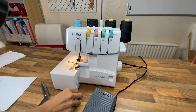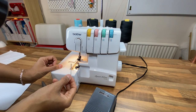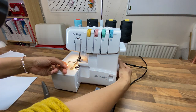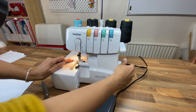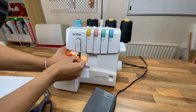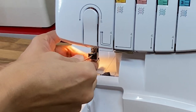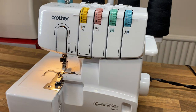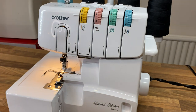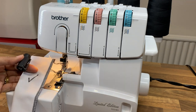Right, first thing I'm going to do is ruin the timing. I've got an Allen key here. I'm going to uninstall the needles — just turn the hand wheel towards you. I've replaced the needle; it was working fine before. I'm just going to bring that needle down — just one of them, doesn't matter which one. I'll mark a tick on the good one so we can compare everything else to it.